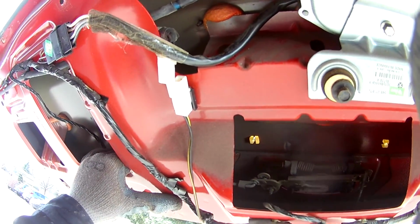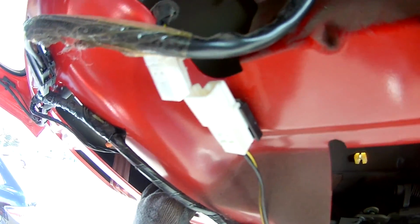There is a small trick over here. You see that light hole, right? That's where the wires are coming inside, from the plate lights. So this is the wire. I disconnected it, so what I'm going to do is pull that outside. Since this is disconnected, it should be easy to pull it outside.